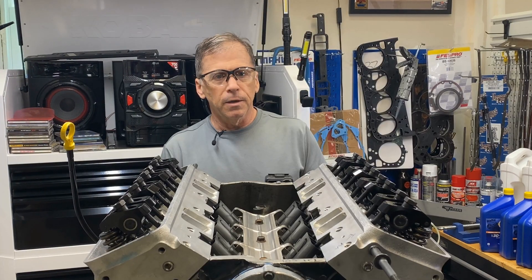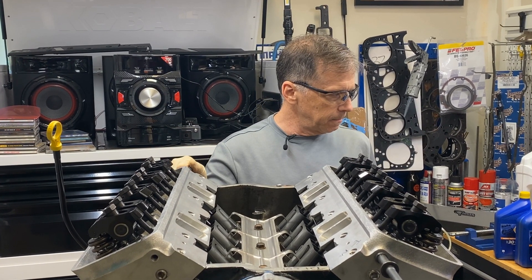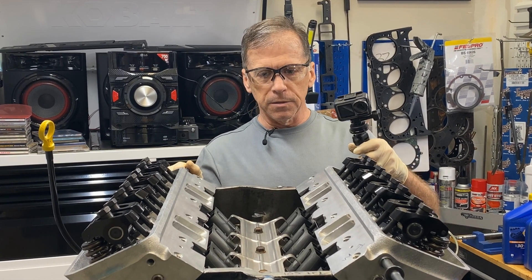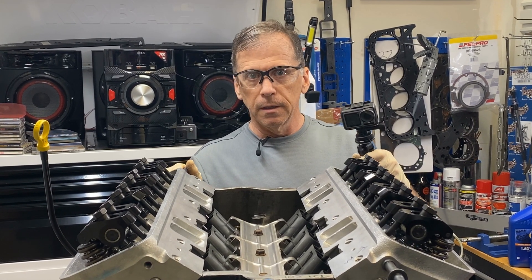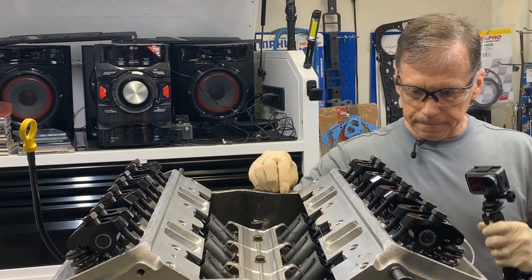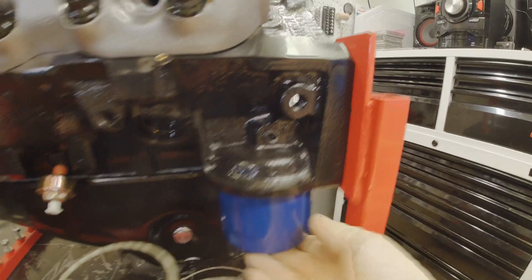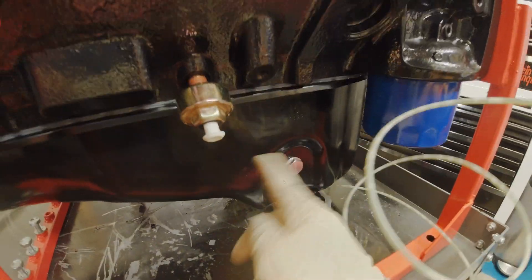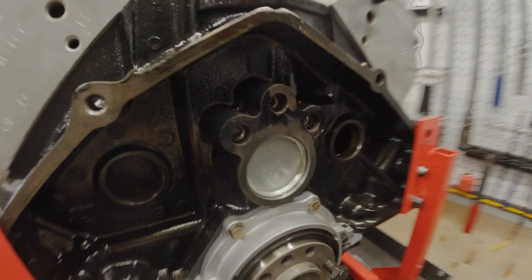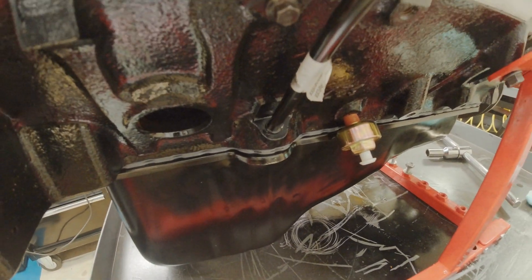Basically I'm going to talk about this process while I do it. The first thing I do is make sure all the oil galleys are plugged. I've checked that probably twice, maybe three times. This oil galley right here — oil filter needs to be on, of course. Oil pan, nice and tight. Oil galleys back here, plugs. Dipstick has that plugged in.